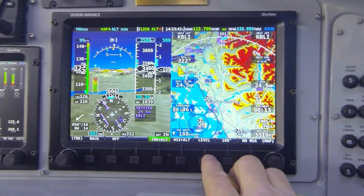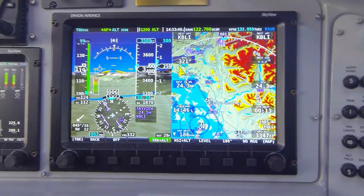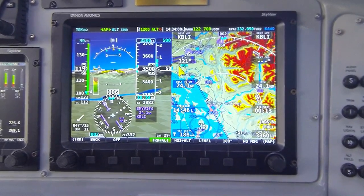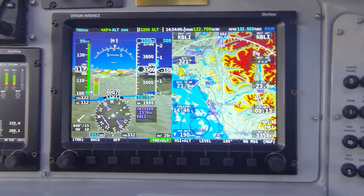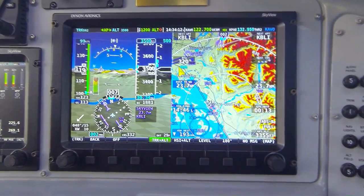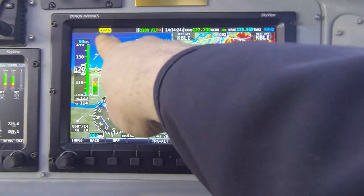Now I want to talk about buttons 6 and 7 — two additional modes available in the autopilot. They're not directly related to following a course or path over the ground; rather, they're intended for special circumstances. The level button is intended for use when the pilot simply needs help controlling the airplane — feeling like he's losing control, becoming spatially disoriented, or already in an unusual attitude. Pressing the level button is a quick way to immediately have the autopilot take control of the aircraft. I'm going to start by disabling the autopilot, pressing button 4 to turn off the track plus altitude mode.